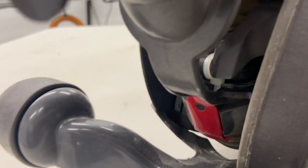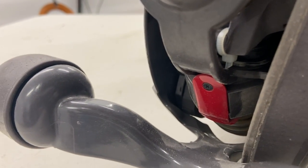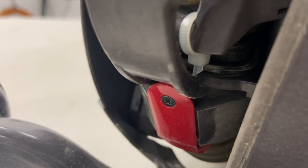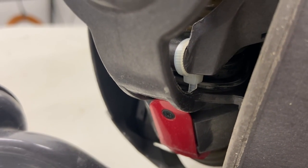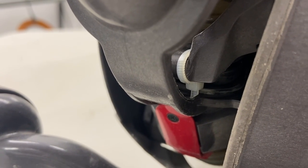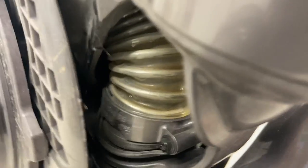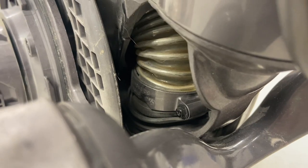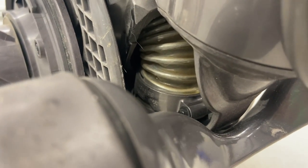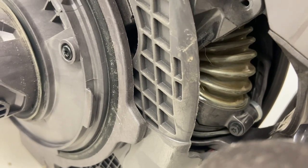Here's what I did. You can see it — I put a little zip tie in there and I made it so that the little tag sticking out is just the right amount so that that seal doesn't close all the way. It seems like a really weird thing to do to purposefully reduce the suction on your vacuum, but that's exactly what my problem needed. My problem was too much suction. You can see that keeps it open just a tiny bit, and it's nothing destructive. It's going to continue to work just fine — you can see the little zip tie over there on the other side.